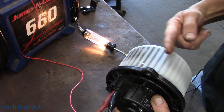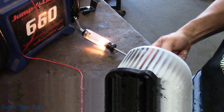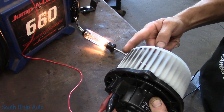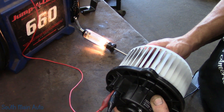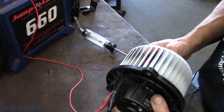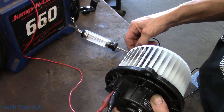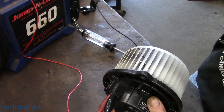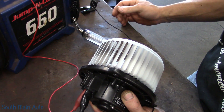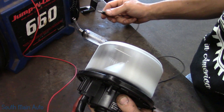I don't know if the camera's picking that up, but you see that little blink it has about every 360 degrees — the light just kind of flickers there. Technically, if we find that dead spot somewhere in this area, the motor goes open-circuited. The blower motor will not work at this point if we were to stick ground to it. Right now I've got power and ground running to this motor, and when we give it a whack, she's going to run.